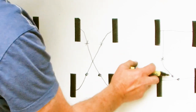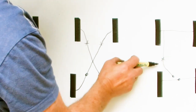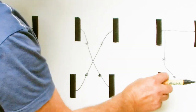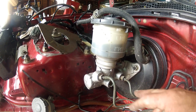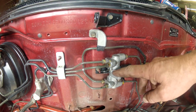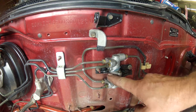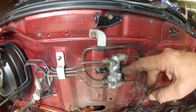There's actually a difference in how you want it set for dirt versus tar — on tar you want even more brake on the front than on the dirt. Once I get the settings right for both surfaces, I just mark the knob and can instantly adjust it. Here's the factory Honda setup: a dual circuit master cylinder with two equal volume outputs that goes across to a block. A lot of people think this is a proportioning valve — it's not. It's really just two Y-pieces joined together with a minor fail-safe, but no proportioning. It's just like a T-piece.